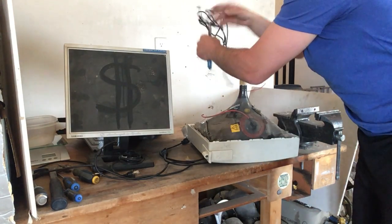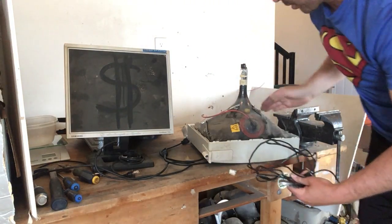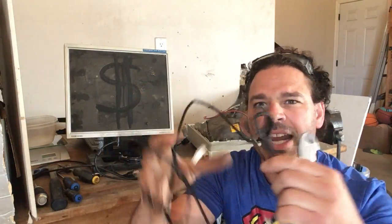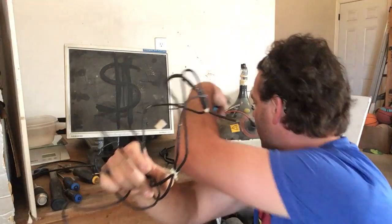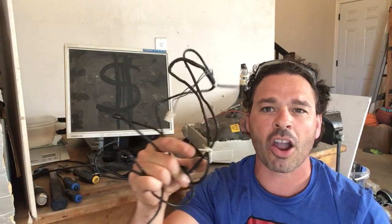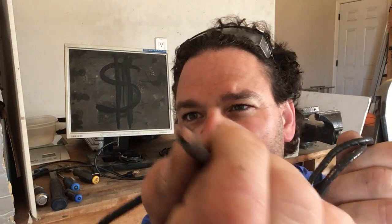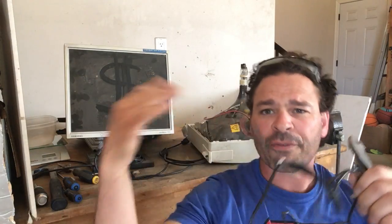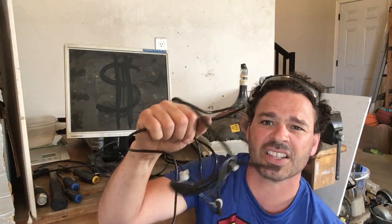Another great item you will find that wraps around the glass tube is your degaussing cable. This one was very hard to find — it was tucked underneath. They are definitely different thicknesses, so you do want to make sure you take a look at this degaussing cable. I have already cut it open and you can see inside that it is copper. If I was to open it and it was a metallic color, it would mean these are aluminum strands, and in my opinion not worth taking them out — I just leave them in for the weight.